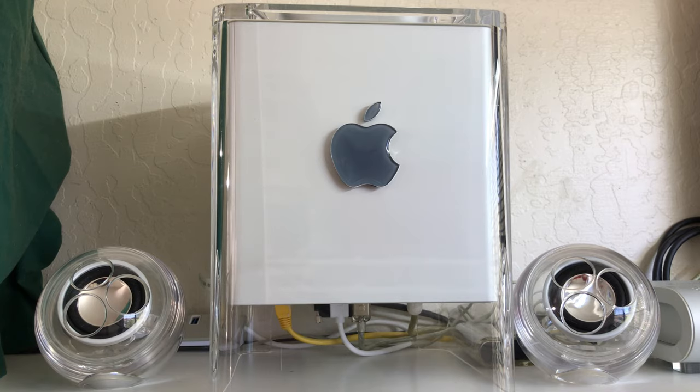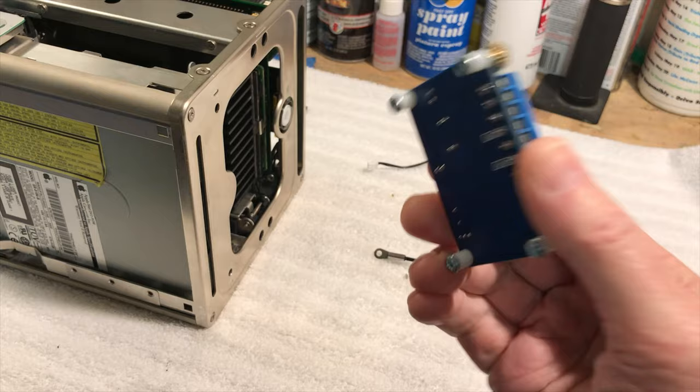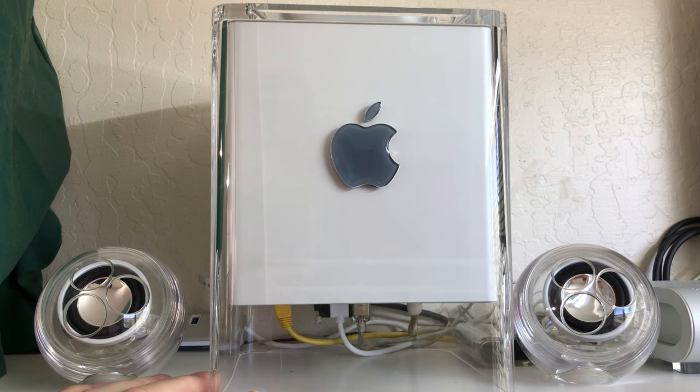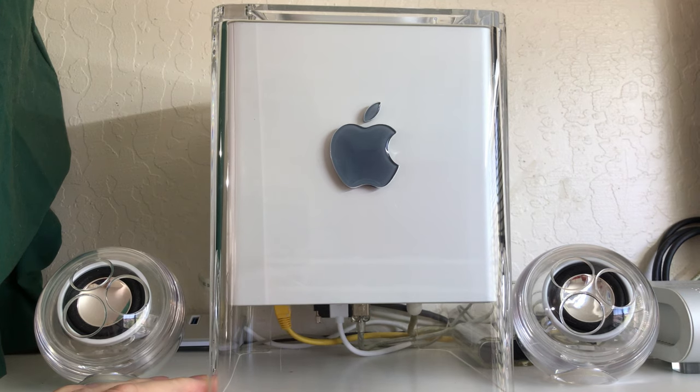And then we put a CNC autonomous fan controller in this Cube, so that it will automatically regulate the speed when the Cube gets hot. The fan installed previously does not have a temperature control on it, so we had it running off the 5 volt. Although it did a good job of keeping it cool, we could not get to full potential. So when we got the CNC fan controller, we were able to run it off the 12 volt circuit, because that is a 12 volt fan that was already in it.